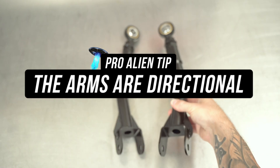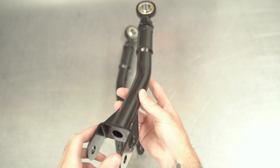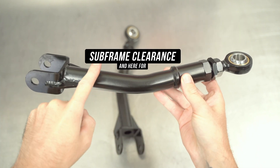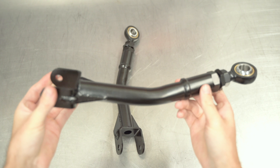Pro tip: these arms are directional. We've removed the left-hand side arm from the car, and the robust Ultra Beefcake GK arm also suits the left-hand side. It bends down from the subframe and away from the wheel to ensure you have clearance, which you can see here on the screen.